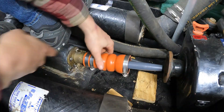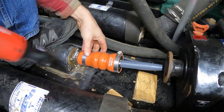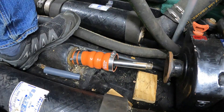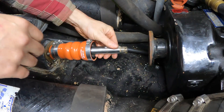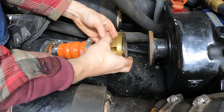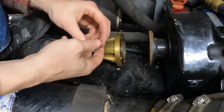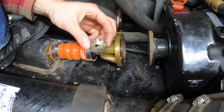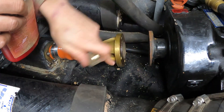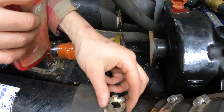Looks like I need to loosen one of these first because they're facing the wrong direction. Make sure I got the key seated to try to get the coupler on — line that up. Now the cotter pin on this was an extreme pain, so what I'm going to use is just some thread locker instead, because you can't access the cotter pin from the side. If this ever needs to get serviced again you're just going to need to crank this out of there, and that's not really a big deal.